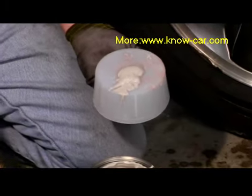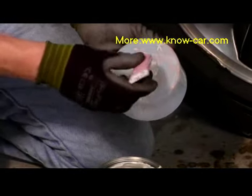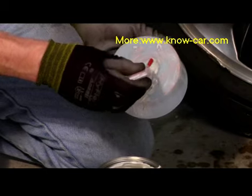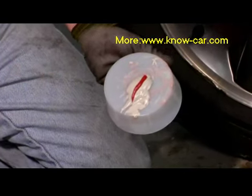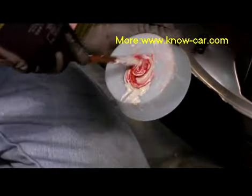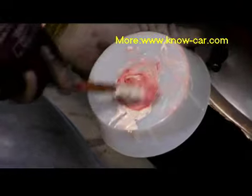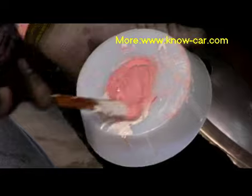It's really not that difficult. If you're really susceptible to the strong smells and they really bother you a lot, this is not something you want to do because this stuff does stink. What you want to do is have a line equal to the amount of body filler that you use. Make sure this hardener gets closed up as soon as you're done with it — the last thing you want is for it to start drying up on you.